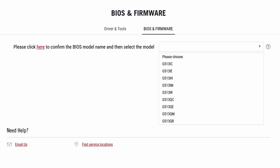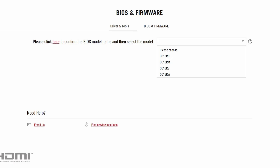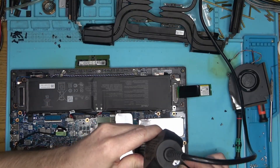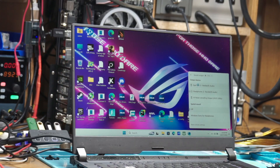I later realized that this laptop came in at least 10 different variations. This particular laptop not only has 4 different submodels, but those models are also different depending on the year they were made. I needed to know which one was made in 2022, with the correct firmware extracted from the ASUS website and flashed to the chip. The computer seemed to recognize a new device, and the sound now works.